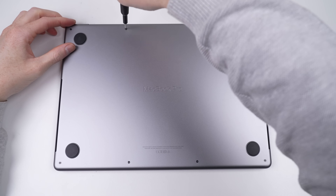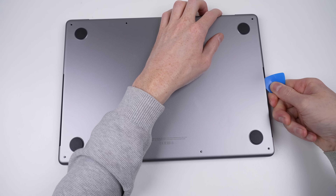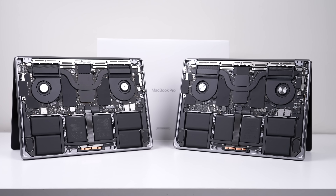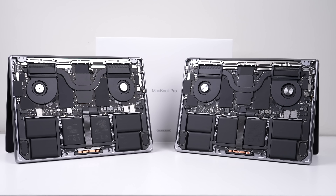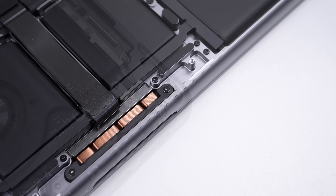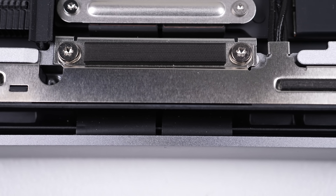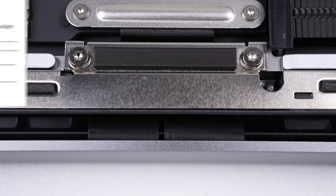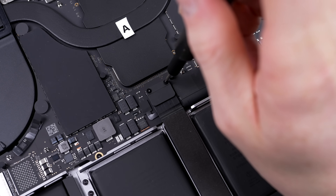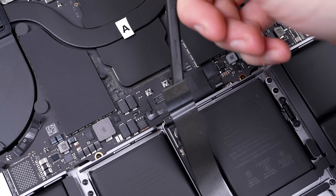Before proceeding any further, I'll open the other MacBook Pro. It's an identical machine that we'll use to swap parts with, allowing us to see if Apple rejects replacement parts on their laptops like they do on their phones. Despite being the same model both with one terabyte of storage, one laptop has extra NAND chips, but other than that these two are identical machines. Apple is still using thin flex cables to drive their LCD display, and I can already see wear on these ones. They have offered free repair to some but not all affected MacBook Pro models where these cables have caused display issues after wearing out.